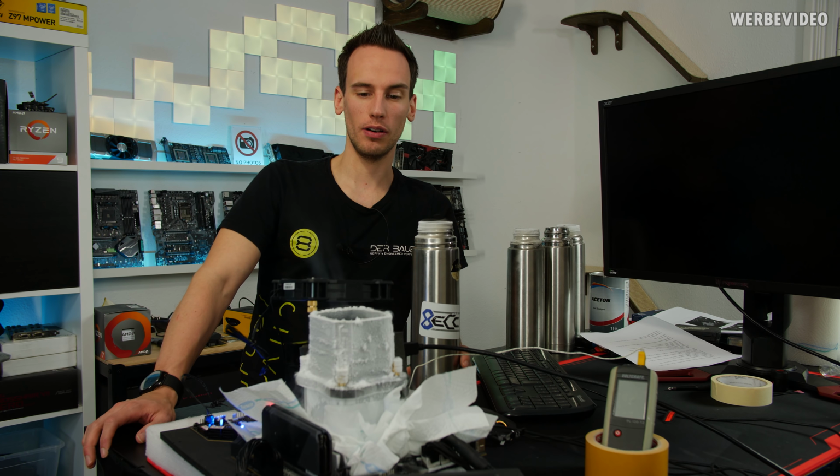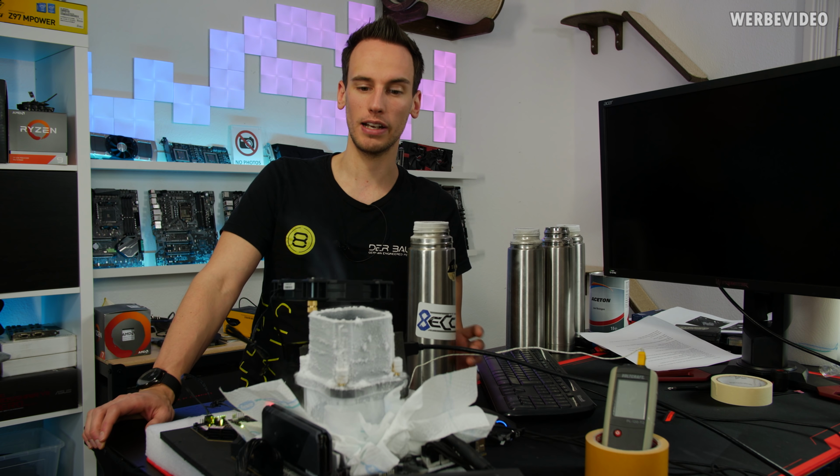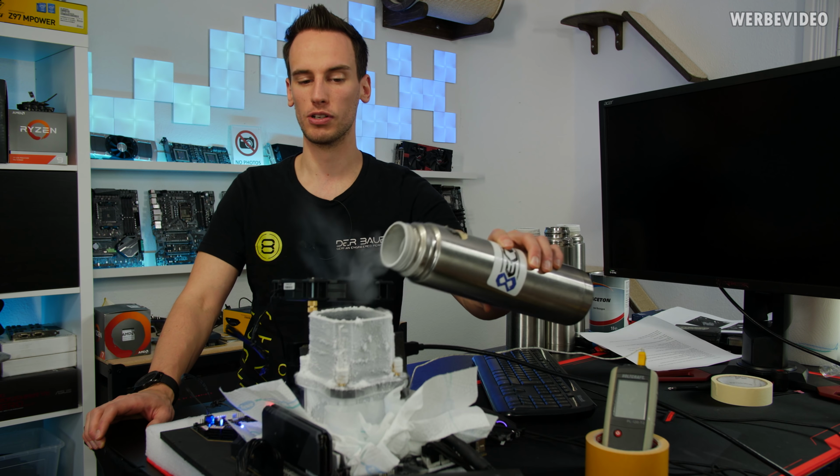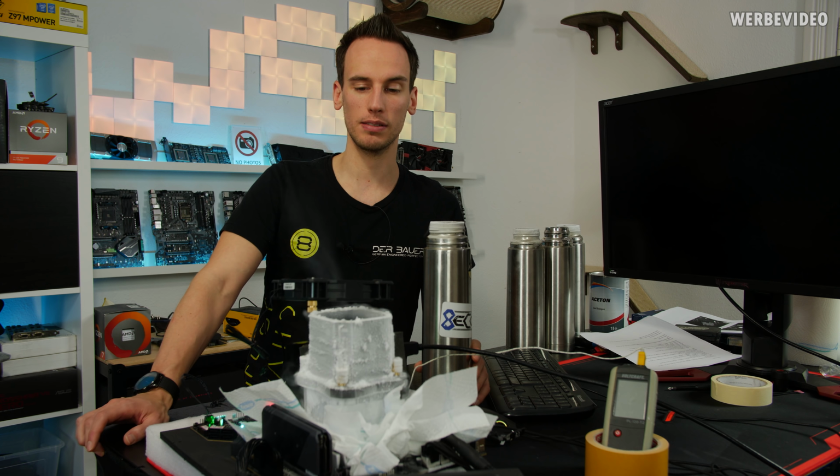I also want to highlight that everything I'm doing right here is running 10 cores, 20 threads. Those CPUs technically allow to run hyper-threading per core, which means that you can also do 10 cores, 14 threads, for example, depending what kind of application you want to run, which is something you can also do for validation purpose. A lot of people are, for example, running only 2 cores for validation and then claim that they're running the highest validation ever on a 10900K, which in my opinion really doesn't make much sense, because, I mean, why would you run only 2 cores on high frequency on a 10 core and then claim you're running very high frequency? Doesn't make much sense.